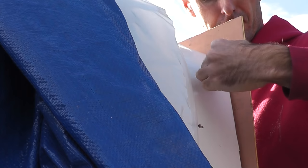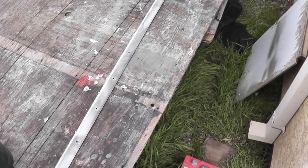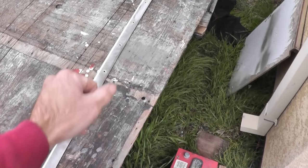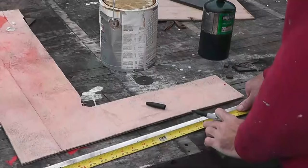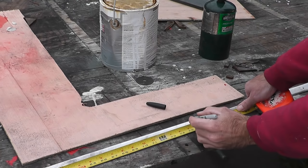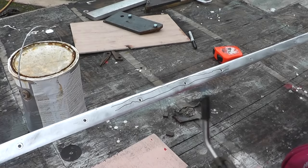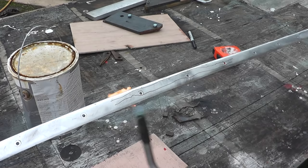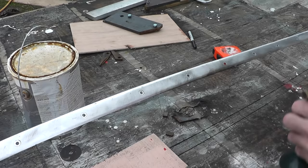The first thing I want to do is trace the contour of the right rear corner of the trailer, then take a measurement so I know where to start my curve. Back at the work table, I'm going to put this trim piece through a process called annealing. When you anneal a piece of aluminum, you heat it up to about 800 degrees, which softens the metal and makes it more pliable and easier to bend. It just so happens that black Sharpie ink disappears at just about the correct temperature for annealing aluminum. So I'll mark the area I want to bend with my pen, then heat it with my torch. I need to be careful — my target is 800 degrees, but aluminum melts at 1200, and if that happens, it's game over.